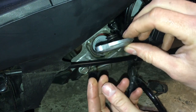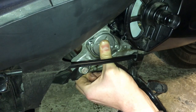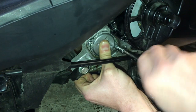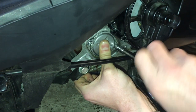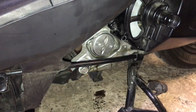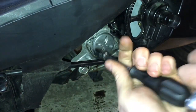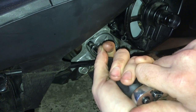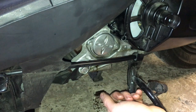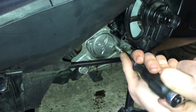We have to get the cap back in here, pressing the spring against the top of the filter to hold it in place, and then get the 8mm bolts in. We've got the cap back on — I'm pushing that against the filter, taking up the spring pressure, and tightening the 8mm bolts. I'll use the little screwdriver with a socket on the end to give a slight extra turn, but I'm not putting a lot of tension on those — they are tight but not very tight.